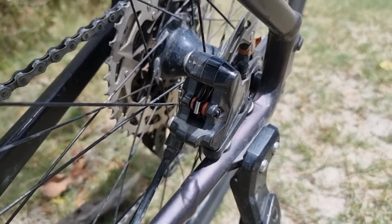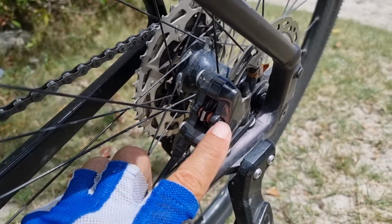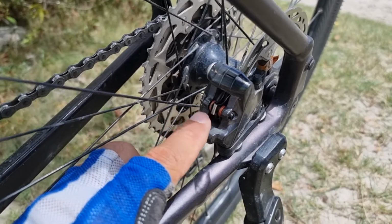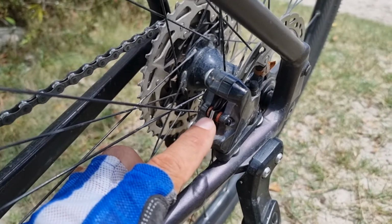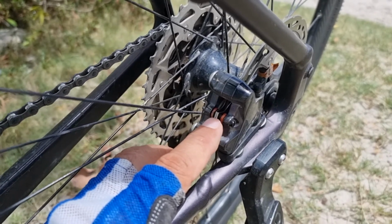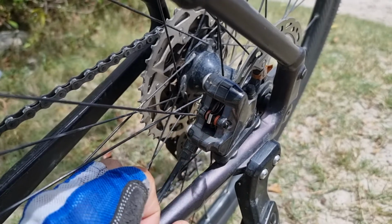So, new brake pads arrived this morning. I've already put them in. The only thing to report was this screw was actually loose this morning when I had to change the pads. I also didn't bother wearing gloves on this one because these pads arrived already assembled with a zip tie holding them in the right position. So I just took out the old pads, pushed the pistons back, undid the zip tie, and then just slid these in with a little bit of wriggling, of course.